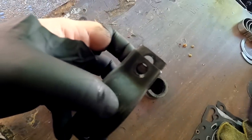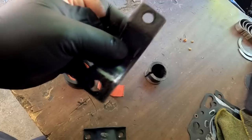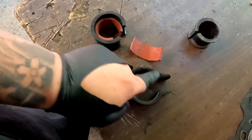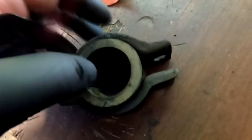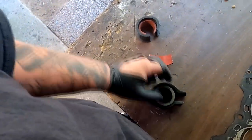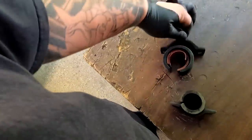and then use a bolt with a washer, which is what I'm already using now, and it'll still secure the bracket, but I don't want the small bushing to move around in this big half moon, you know what I mean? So this obviously fits perfect in the curve, while the small bushing in the big bracket, which is probably the same half moon on the subframe, I don't want it to move around, and that might cause clunking issues. So I'm trying to figure out a solution for this, and if I can't, I'm probably just gonna throw this back in and use it like that.